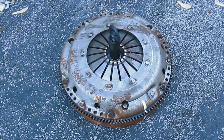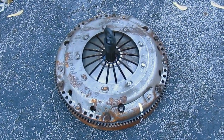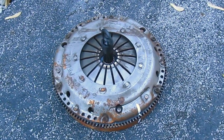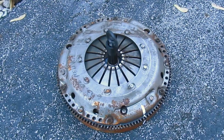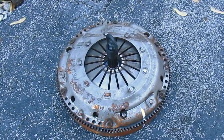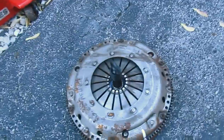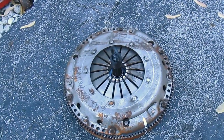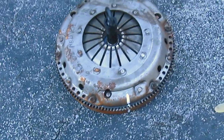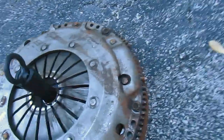You're just pumping oil from your crankcase trying to lubricate that center turbo shaft — that's what's called a runaway. While it was doing that, it was actually filling up the intake with oil, and that oil, even when you shut the car off, dumped into whatever valves were open. I think it was the number one and number two cylinders that were completely filled with oil, and that's why I'm showing you this flywheel, clutch, and disassembly.